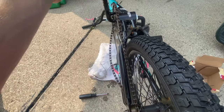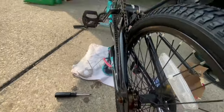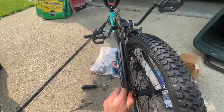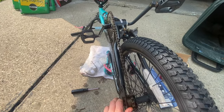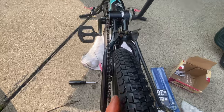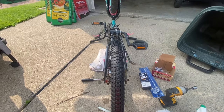As you can see, the chain is going to be extremely loose. Pull back on the tire until it puts enough tension on the chain. You don't want it guitar-string tight — you want a little slack. You also don't want too much slack or you'll be fixing it every time you go around the block. When tightening the two nuts, pay attention to the front — this keeps the tire centered in the frame. Make the distance between each side of the tire and the frame approximately equal, then tighten your nuts. The wheel is free-spinning with the correct chain tension.